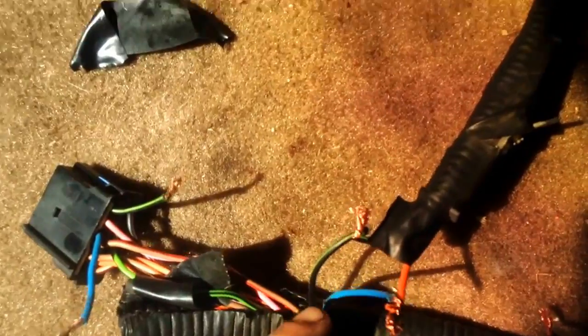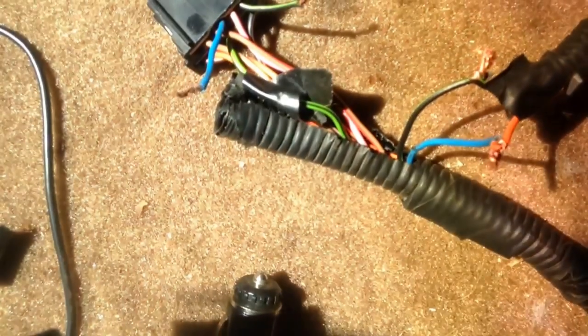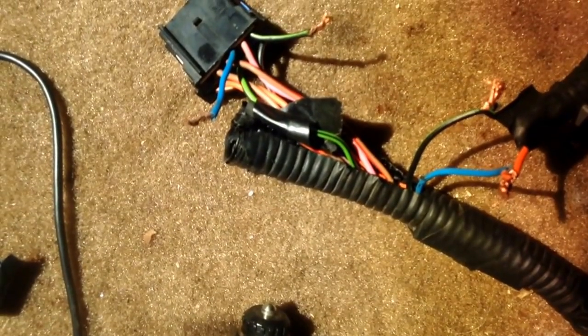I hope this video helps you with fixing your problem. But let me run through it again. You want the black and green, not the green and black. Black and green. And then the solid blue wire hooks up to both your orange wires. That was the only problem I ever ran into: I cut the wrong wire. And when I cut the wrong wire, it shorted out my battery and I had to charge my battery to turn my truck back on, but I haven't had any problems since I did this.